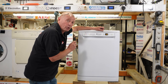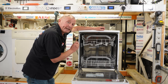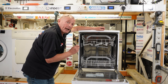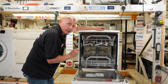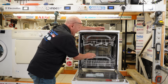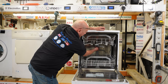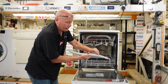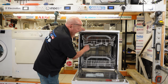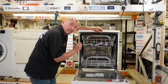There are a couple of faults that can occur when the dishwasher is not washing correctly. Firstly, if the machine has insufficient water going into the machine, it's unable to build up a pressure which would turn the spray arms. Spray arms have no mechanical parts in them — they are completely controlled by pressure. If the water has not got to a reasonable level inside the dishwasher, the pump may only be filling half the system and the bottom spray arm may be turning, but the top spray arm may not be turning.